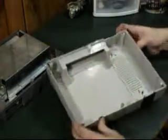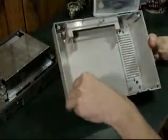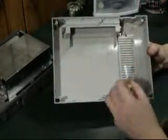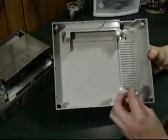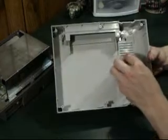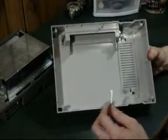Before we put the top on, we want to make sure that we clean this out really well. This is where your carts are sliding in, so you want to make sure it's pretty clean. Take the Windex and spray out the big areas, use your cotton cloth to wipe down the big areas, then take your Q-tip and get in the corners and little cracks and nooks to get all the dust out. There's also another set of intake ribs — it's tough to get in there with a Q-tip, so use a toothpick or a small flathead screwdriver to scrape as much dirt out as possible. Get it as clean as you can.